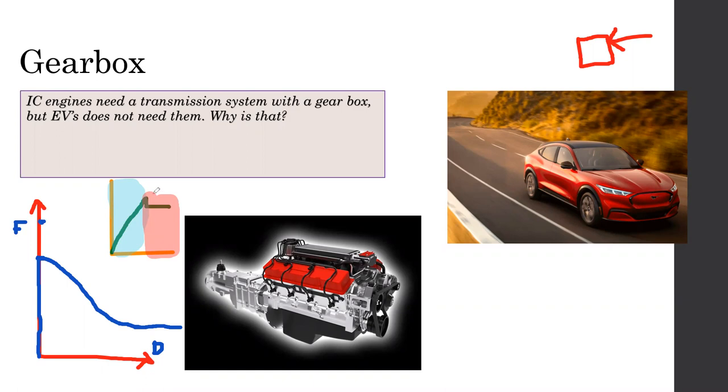So as you can see over there, there's a small sort of drop. This drop is actually the reason for this. We have to increase our force until it breaks out from that static friction coefficient. So until then we have to increase, then it starts to go down up to a certain point and it will continue. So this small section is the reason for this particular graph, right? This particular graph is actually created by this small drop over here.